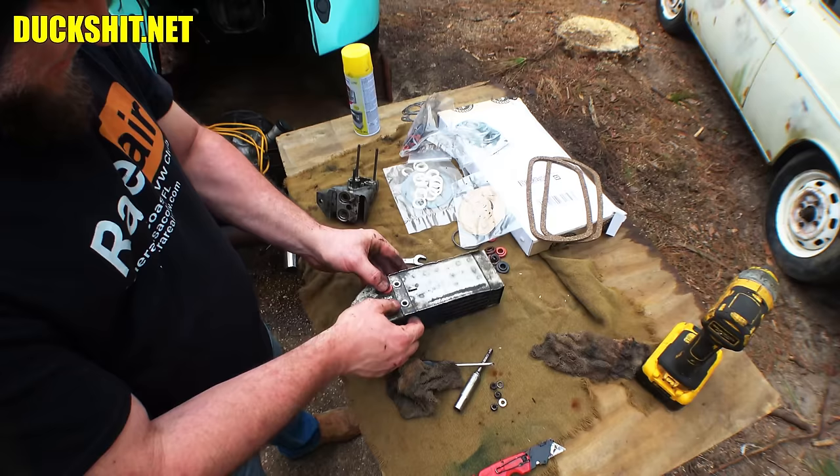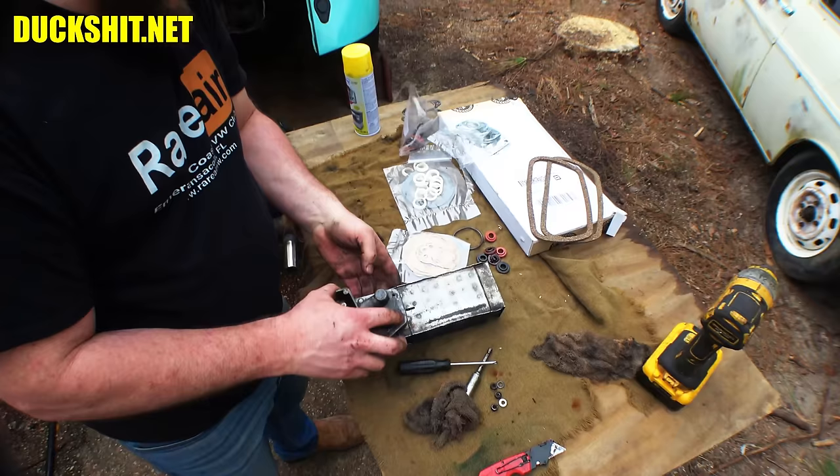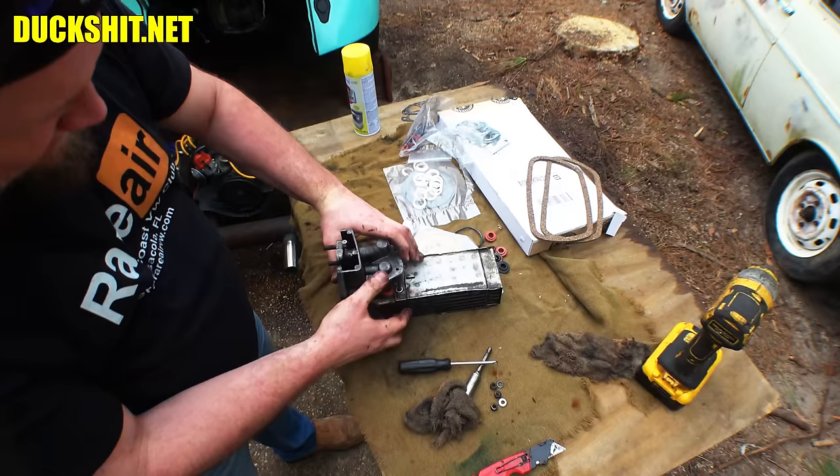Looking through the harmonica here, you can actually see light through it — there's no paste, buildup, or crust. That's one reason I didn't think this oil cooler itself was leaking. It looks like it was all in the rubber gogis. So there are our new gogis, just like so, and we take our adapter and put it right in there. One gogi fell out but it's back in — and one on the other side. Good.